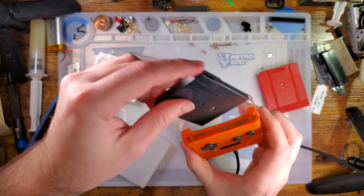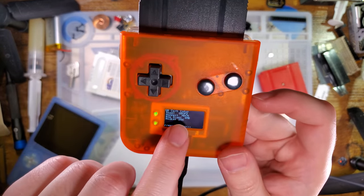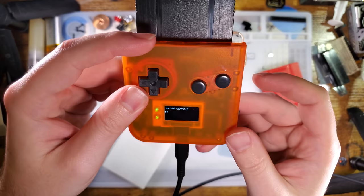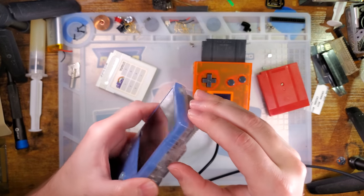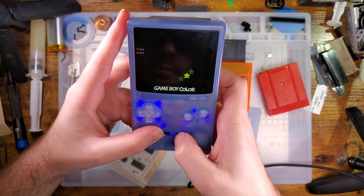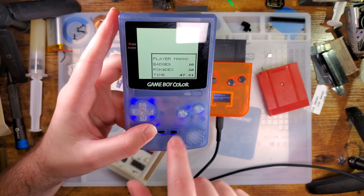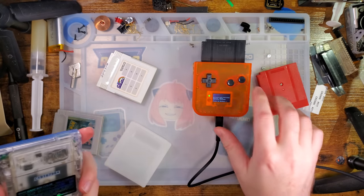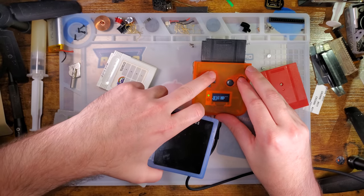Let's get started on this one. I'm going to go ahead and dump it first — you can see it shows up as GBVP2, because that is the software that was used to create this ROM. I don't know that I have a backup of the ROM, so we're going to dump it before I overwrite it. Pokémon Silver — I just dumped that. As you can see my save game — Mako, 47 hours, 31 minutes, 16 badges, 32 Pokédex. Check — excellent. So now let's try flashing it. I'll select 29F Cart MBC5.